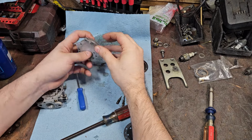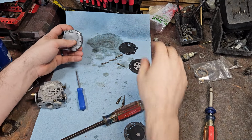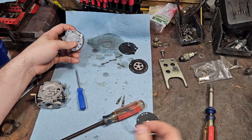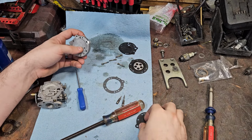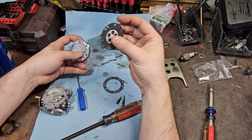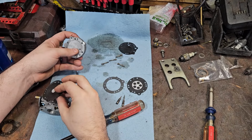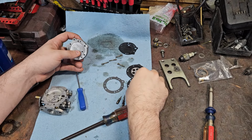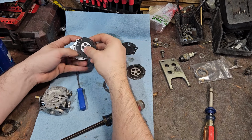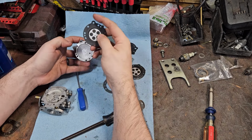Again, one side's a gasket, but the other isn't. But it was rubberized back in the day. I don't know. It's weirdo stuff. Your pump, so you can put it down here first if you want on the nubs. But your pump goes first. Your gasket, remember. You're assembling like this, gasket, then your pump. You're doing it upside down like me to line up the holes and everything, which you kind of orientate off of this top part here.